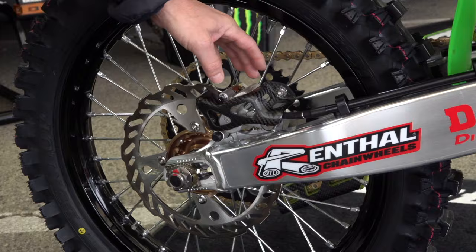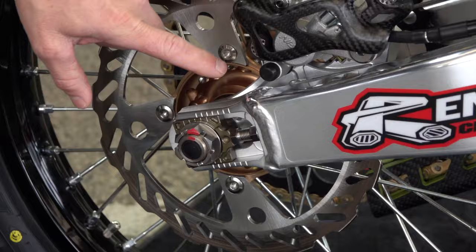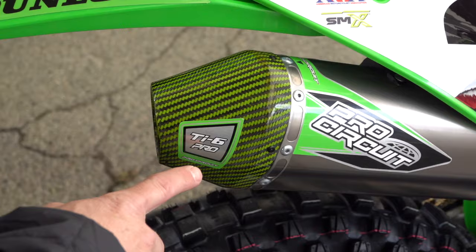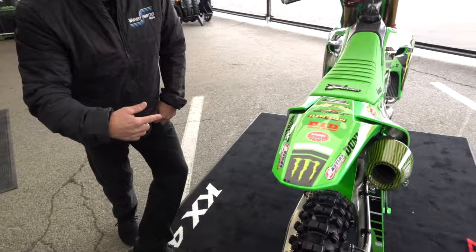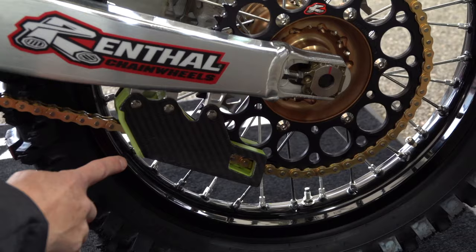And on the back, it looks like a stock rear brake caliper, but you can see all this stuff is magnesium, titanium — these drilled washers with the carbon cover. Beautiful. And then the Pro Circuit exhaust — the Ti6 Pro, the Pro Series, is actually quieter than just a Ti6 you'd buy off the shelf. That's so they can meet the AMA sound requirements, so there's a reason it's a Pro model. This whole chain guide is made by Kawasaki, a little bit longer so it makes sure the chain can't derail. And this plastic is a little bit harder for more durability for these guys.